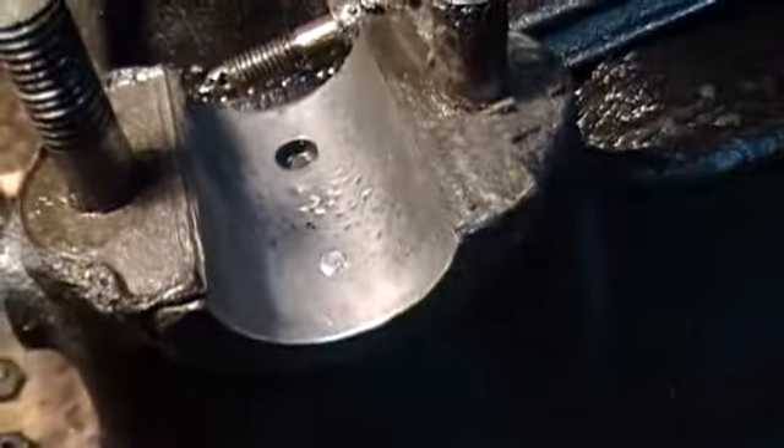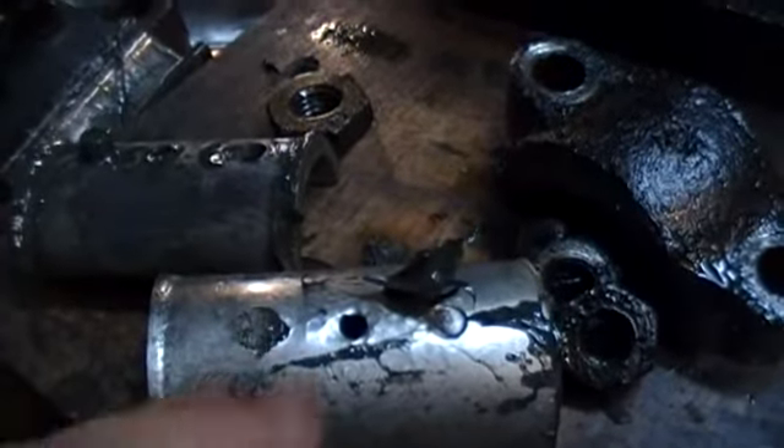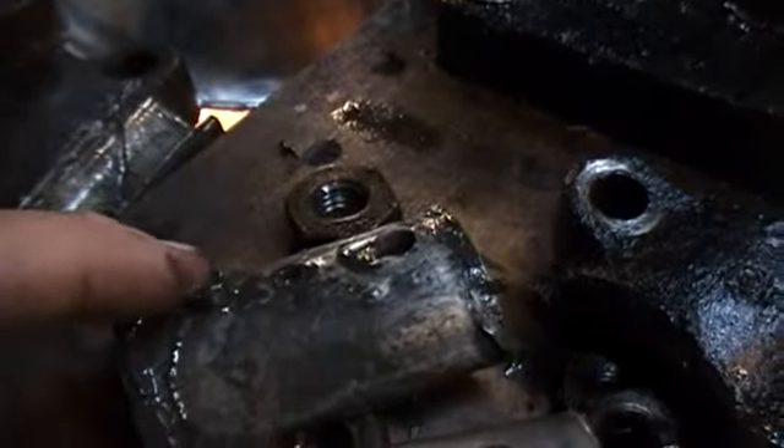So I'll just go ahead and replace that and we'll be good to go. The seats don't look bad — a little pitted but I think that's just casting defects. Another thing was the little bumps — see that? That's got that little raised bump right there. Well on the other ones the bump was broken off. One of these little seats keeps the bearing located, and its notch was broken. So that can't be good.